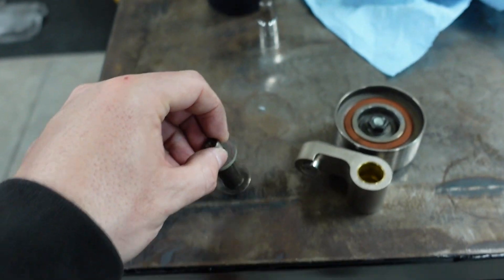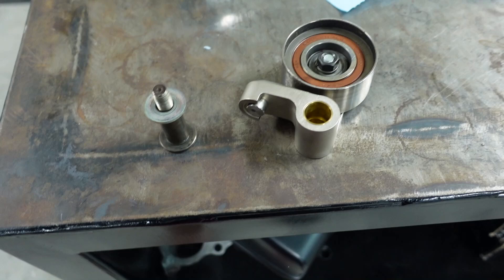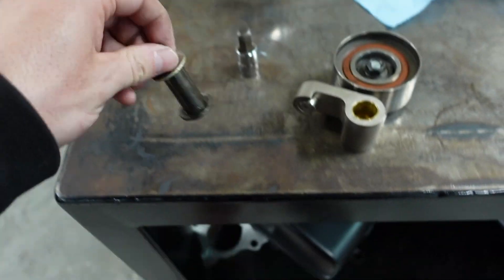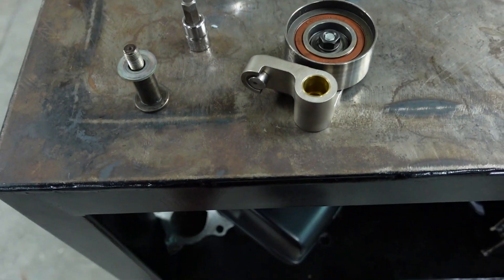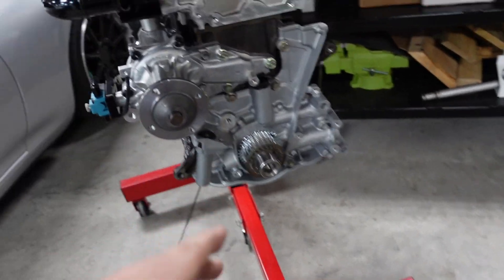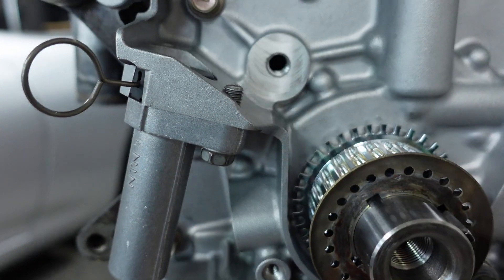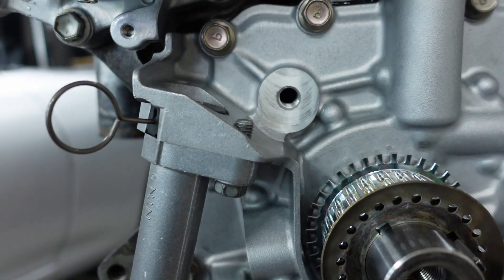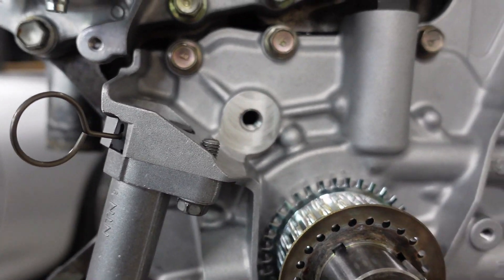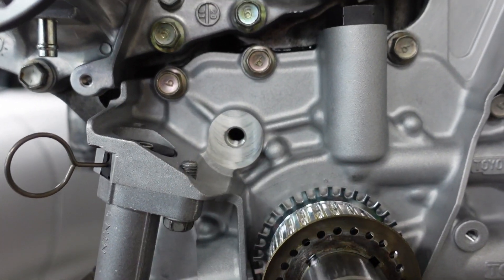This only goes to like 28-29 foot pounds — something small. In the past I literally just cranked it down by hand with blue Loctite, but this time I'm actually going to torque it down. The bolt takes a 10mm. Now, this hole — if you look inside, it actually goes all the way through into the oil pump. I've never had any leaks, but put some blue Loctite on it and make sure it's cranked down, because if not it will leak out of that hole. If you don't crank it down properly, it could leak down near your belt, and you don't want that.